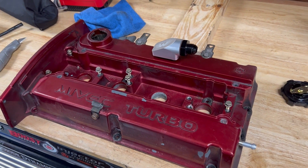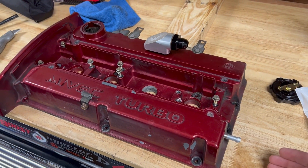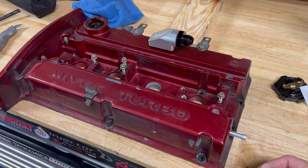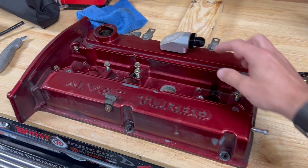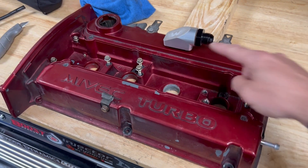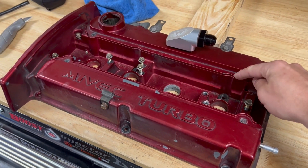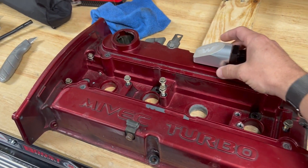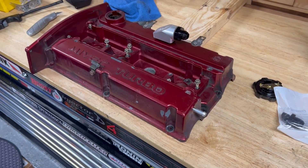The hope is to obviously get enough ventilation and not get any oil in the intake, and also not get a ton of oil in the catch can. Hopefully, with this being mounted up high and keeping the stock baffles, plus the two baffles this fitting has built in, that's going to keep a lot — or all — of the oil out of the system.